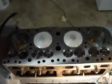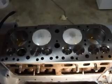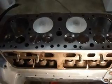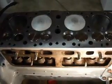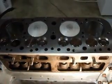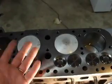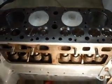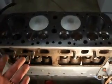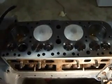You might want to get together with someone who really understands machine work and go from there. I was just reading on the internet that there was a Farmall Super M. They said they totally rebuilt the engine and now it's locked up. It won't go. I'm not saying what's wrong with it, I don't know, but there is a very good possibility that they just swapped parts and didn't do their measuring, especially with the cam and the bearings being so off these days. You could run the tractor and spin a bearing and bam, that's it, you're done. All that work you did was for nothing.